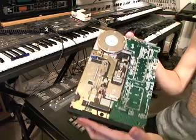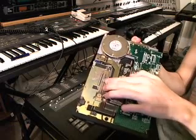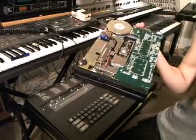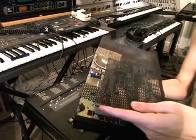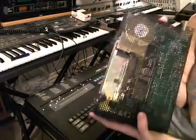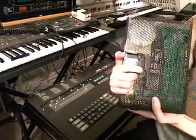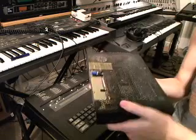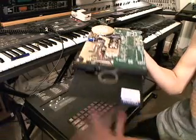By the way that sounds, I know it didn't do it right — it should have made this sound. That copper ramp should have forced the wire to go over it, but it didn't. So what I had to do with my unit, because I actually got my disk drive to work a few times — you'd actually have to line up the hole exactly and use something like a toothpick or thin plastic piece to shove the ramp down and force that metal wire to release over the ramp to release the disk. Then you push the center, it comes out, and then all will be good.